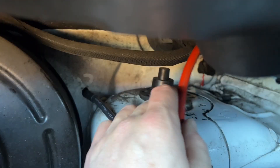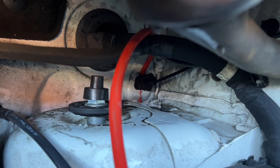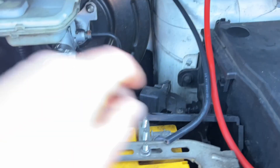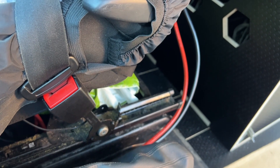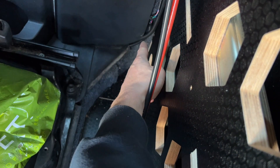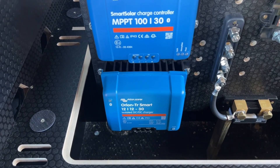I've heat-shrinked around the cable for a bit of extra protection. The live wire goes through an existing cable hole for the bonnet release, but it was just too tight to get the black cable through there — which doesn't really matter because they're both going the same place once they go the other side of the bulkhead. I've given myself enough space to terminate these onto the battery, and that's what will charge the battery, essentially. I'm going to run it around the console, straight down the side of the seat, behind the seat, and then under the carpet. The cables are already poking out, and I'll feed them through the hole and straight into my charge controller.